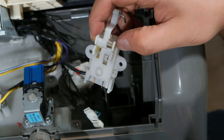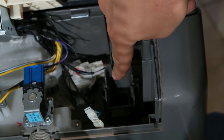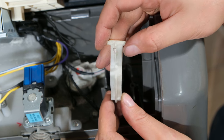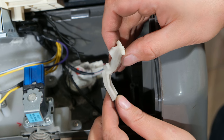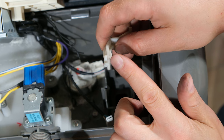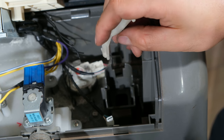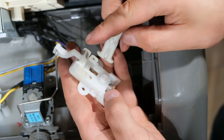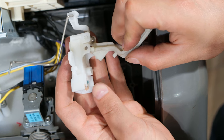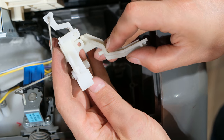I'm going to lift the machine and look for a plastic piece with a finger that goes into the switch. Good news — I found it on the floor of the machine. I'm a bit concerned because it looks like there's only half of it; there was definitely a break here and the finger was much longer. Putting it next to the switch, I can see it's definitely supposed to be part of it — the holes line up.